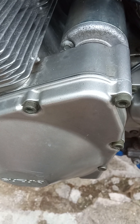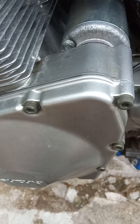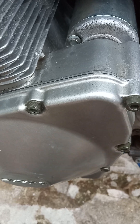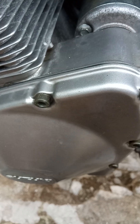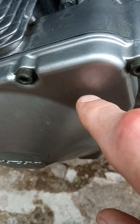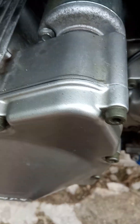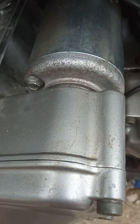Hello folks, this is How To Bloke Back again with a quick one Sunday afternoon. My son and I just finished servicing this starter motor here. It hasn't got a Bendix on it like the old style things — it's got a sprag system here. The little spindle comes out and engages in the sprag clutch and drives the crankshaft around. This particular bike is a Suzuki GSF 600S Bandit.